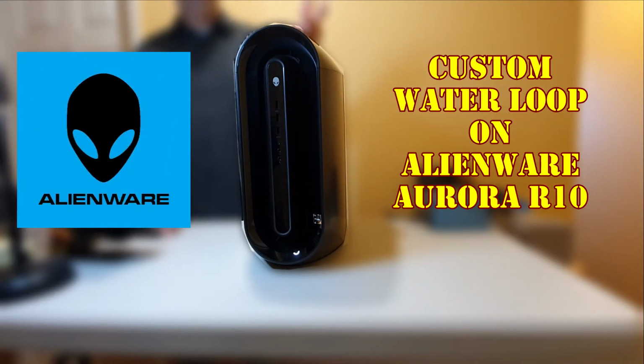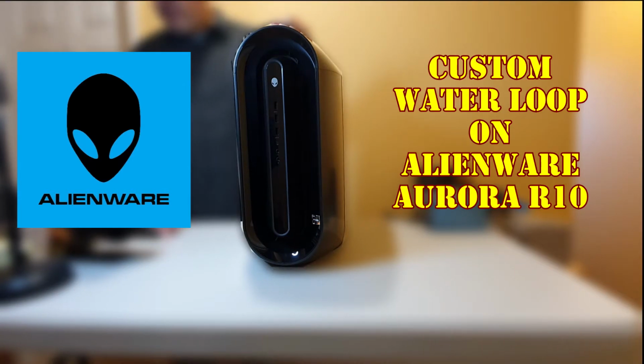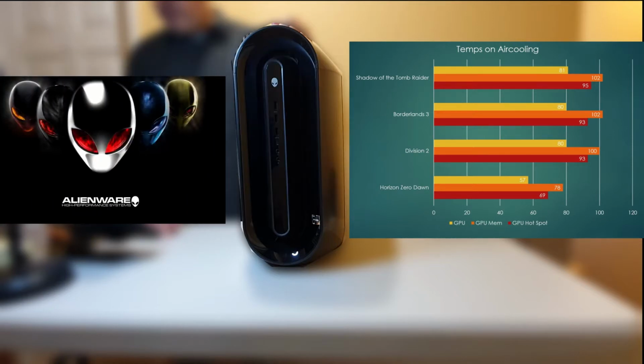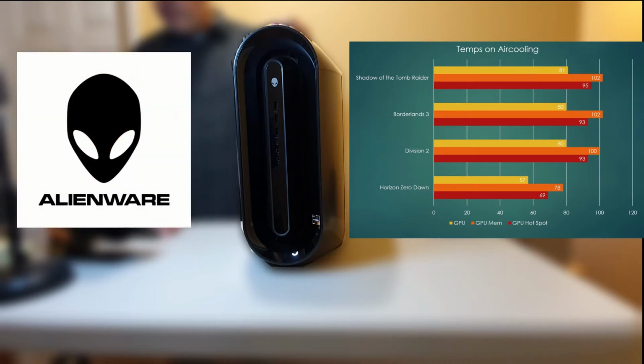So that affects the CPU performance and the GPU performance. The GPU has two fans on it. It's a two-slot design on the cooler, and it does a fairly good job of cooling, but because of the bad airflow in the case, temperatures get really hot and it starts throttling under heavy loads. I saw temperatures on the GPU memory above 100 degrees. I'll try to show you some of the temperatures on screen before and after the mod, so you can see the improvement.